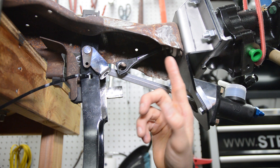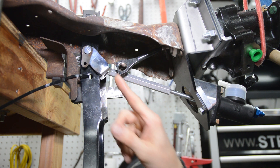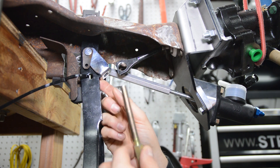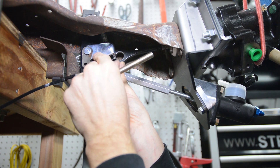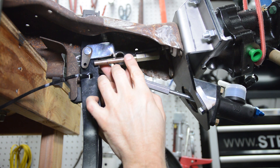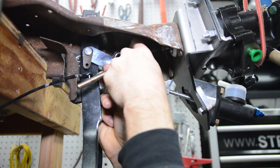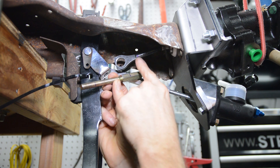Here's what the setup looks like installed. The push rod is an eyelet which does us no good — we need to go to a threaded clevis, so I bought a new clevis from Inline Tube since my pin was worn out. You can push the rod sideways and line it up. I made several marks on this push rod and I plan on cutting at the blue marks. The rod is threaded all the way through to a certain point, so I'll have a little stub on the push rod that fits into the clevis, weld it up, then cut it to length.